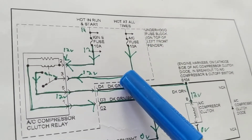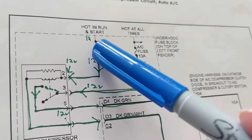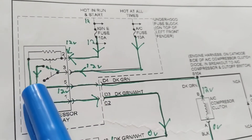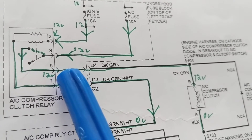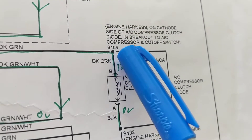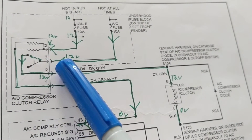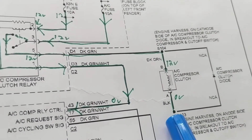Now go through the AC fuse over here. Notice these diagrams will not give you a battery symbol — you have to infer that whenever you see a fuse, it's coming from the battery. We go through pin 3; when the switch is activated, follow the arrows coming out through pin 5. On pin 5 you have 12 volts on a dark green wire, which goes to splice S104. So basically we have the 12 volts we need coming through the switch of the relay when it is activated, and only 10 amps is being drawn.